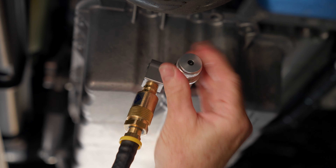And as you can see, it's already in the container. Now basically the oil is out of the engine — you can see it's sucking air, the hose is moving. It's a little bit of oil and mostly air coming out, and that's about it. So while the little bit of air pressure is still in the tank, you're just going to release the valve by unscrewing it here. And once that's out, we can remove the tool and no oil will be spilled, dripped, or anything.